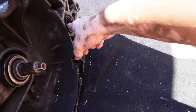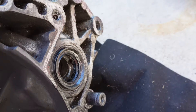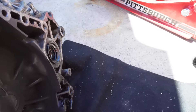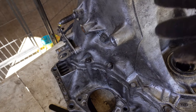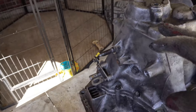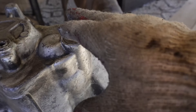Depending on what's wrong with this one, I may replace whatever part is broken on here with the part from that one and come back to that one later - or sell it, because it's a good transmission. I just got to get that snap ring on. Look at all that metal right there - I'm thinking this thing is going to be toast. In that shaft, around that bearing - I think the bearing probably gave way. We got both transmissions up here, B16 and B18 LS transmission cases, and they look very similar.